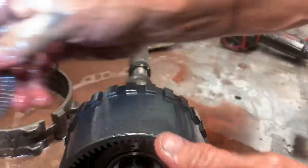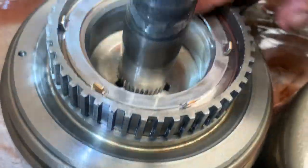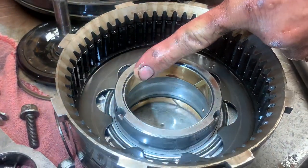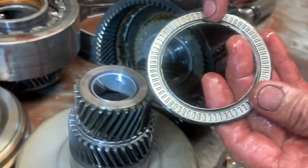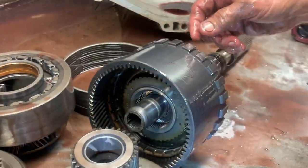This tranny has been changed multiple times — from thrust washers to bearings here, and the depth of this drum has changed too. They made this shorter, and when they went to a bearing here they got rid of this washer. What's crazy is the bearing looks almost identical but they will not interchange, so you've got to be careful.